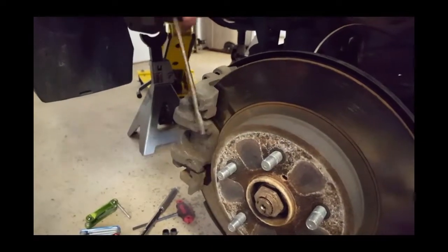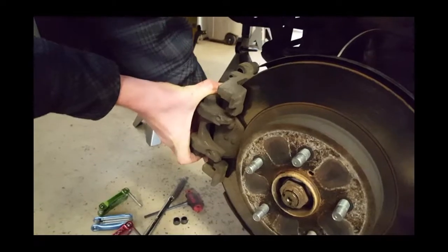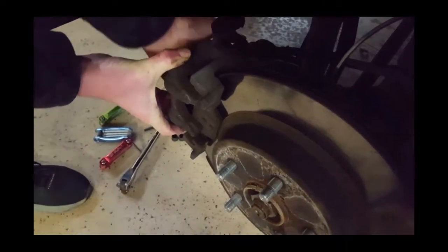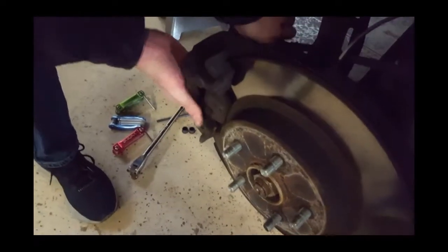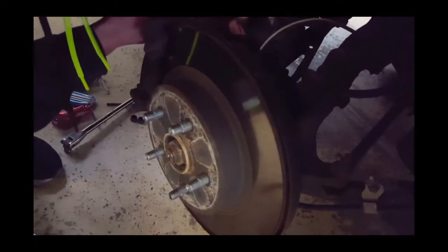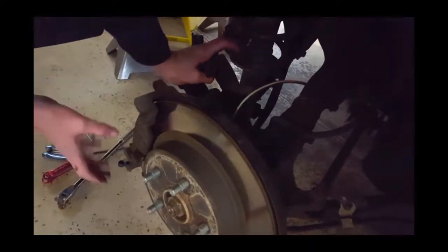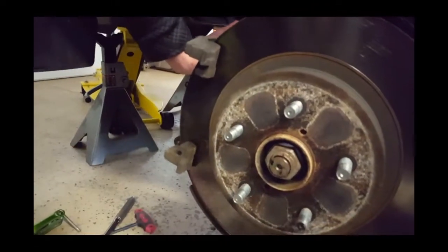Now we're removing what I'd call pins from the front of the caliper to allow you to take them off the rear caliper bracket. Subaru also has a very complex rear braking system that's electronic, used for emergency braking and adaptive cruise control. Some people think you need to take it to a dealer to have them electronically put it in a maintenance mode, but we came up with a way to bypass that, which is much more cost effective for people maintaining their Subarus at home.